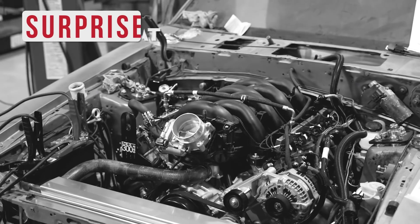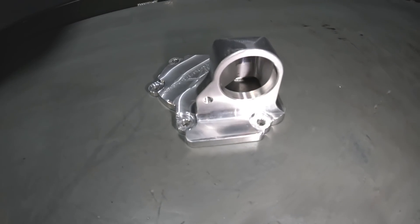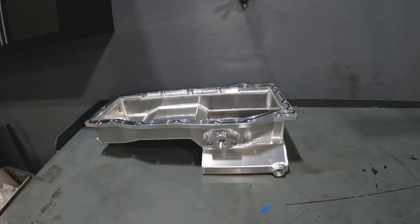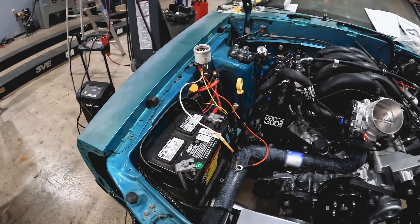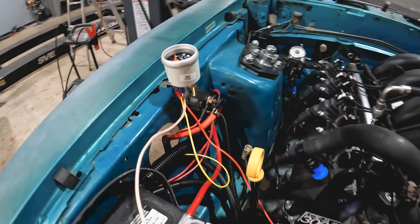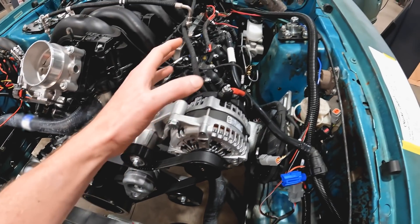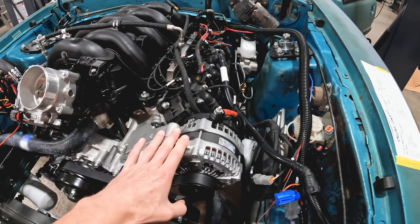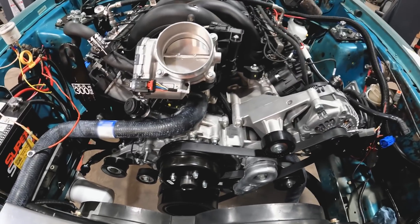With the car on the lift, we'll start up top and work our way underneath. Here in the engine bay on the passenger side, we've got a simple battery solution — negative and positive going to our solenoid. This little gauge here is just a makeshift oil pressure gauge so we can monitor oil pressure. Over to the alternator — this is just an alternator off of a newer F-250 that comes equipped with a Godzilla engine. All we're turning accessory-drive-wise is a water pump and the alternator, so we should see a little uptick by freeing up some power and torque.